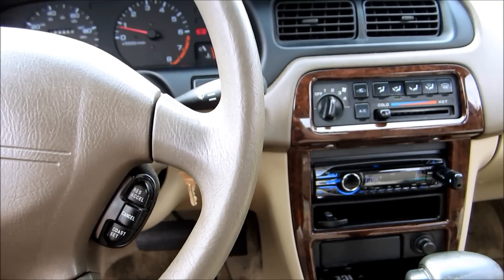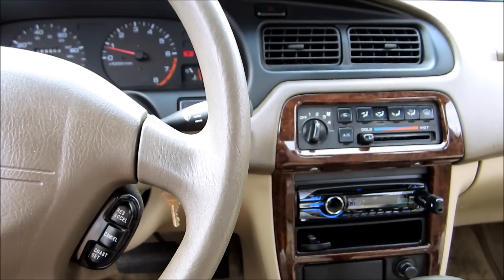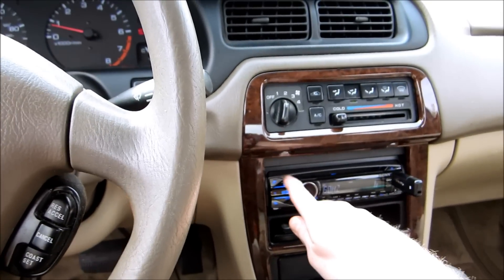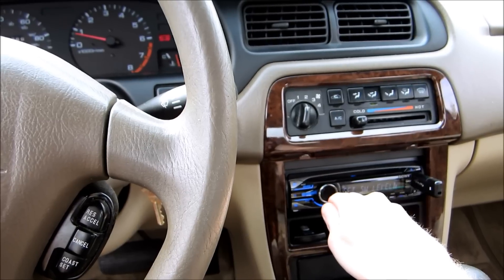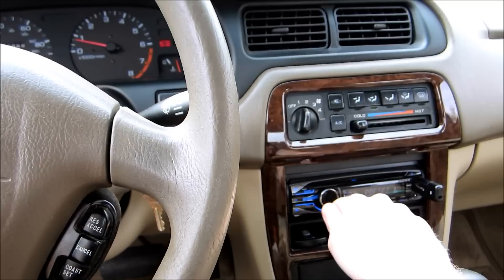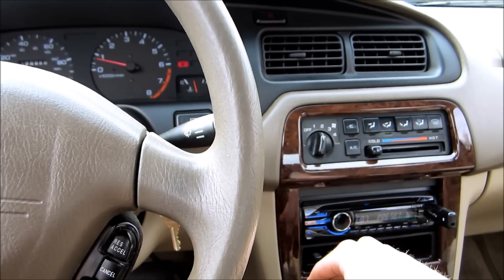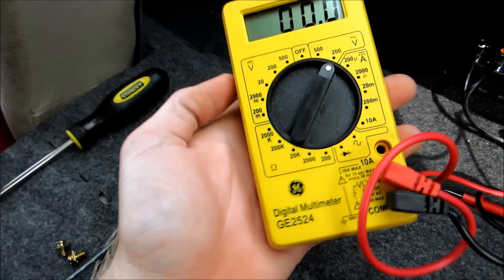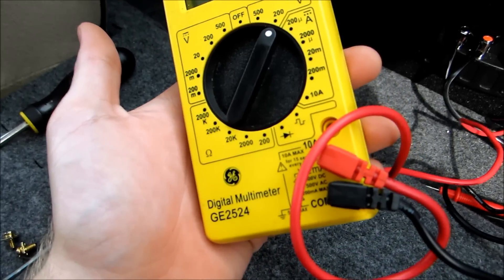I'm going to show you now. First thing you want to do — I'll have a link in the description below — you're going to download a 60Hz tone, basically just a tone you play on loop on your head unit. You want to go turn everything flat: any sub enhancements, turn them down to zero; any EQs, turn them completely flat. You just want to tune your amplifier completely flat with no enhancements whatsoever. Then go to Walmart or anywhere and pick up a digital multimeter — I got mine for about 20 bucks. All you really need it to do is read in volts.